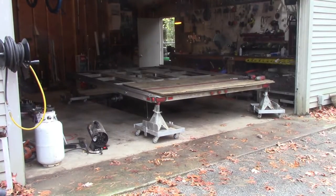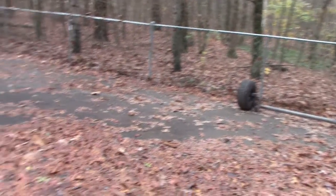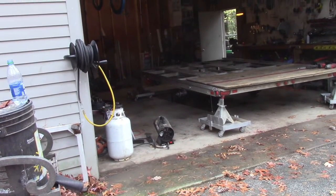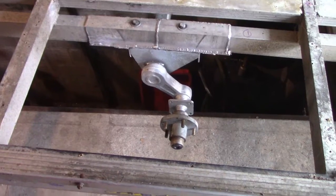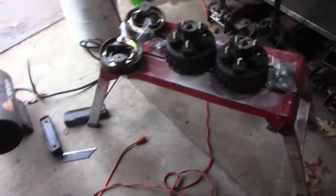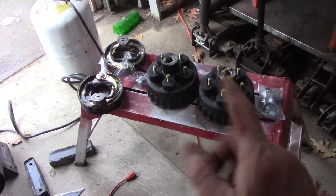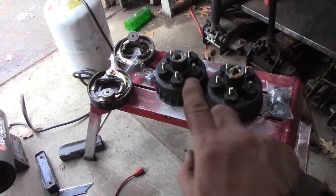Hey, John here again. We're doing some work on this caravan trailer, a snowmobile trailer clamshell. We just replaced an axle — this bent axle was giving me problems with tires. But today I want to finish this thing up with trailer brakes, because most of these clamshell trailers don't come with trailer brakes, but they're cheap enough and easy enough to put on. So I got these from trailer depot or e-trailer, reasonably priced — I believe they're Dexter. We're going to swap out those idlers, put these backer plates on with the brakes, and then these hubs.